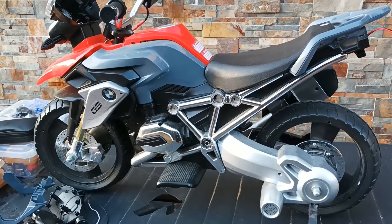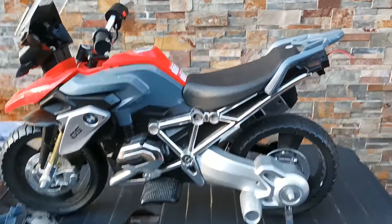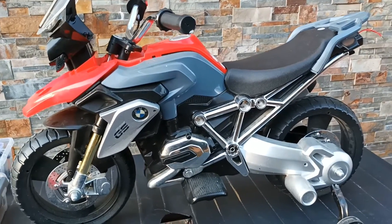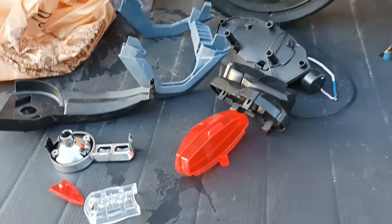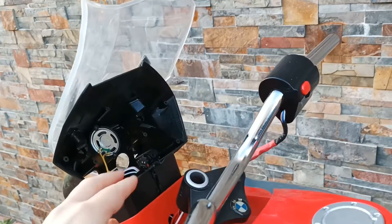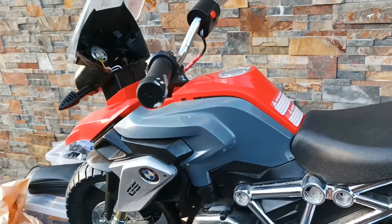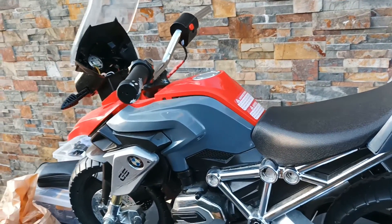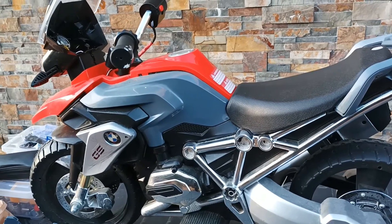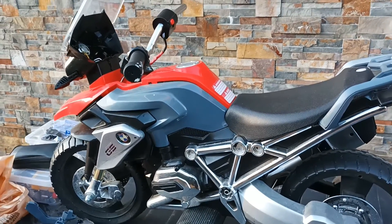Today I've got another project: a mini electric motor for kids. I got it in a broken condition and I need to repair it. I need to put all the parts together. First, we have to check all connections and cables and not connect the battery directly to the motor, because in case there's a short circuit you can burn the cables. We'll disassemble some parts, check whether the motor is working, and I'll show you how to check cables using a multimeter.